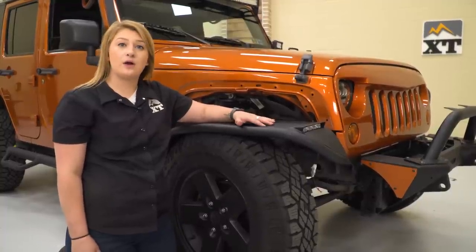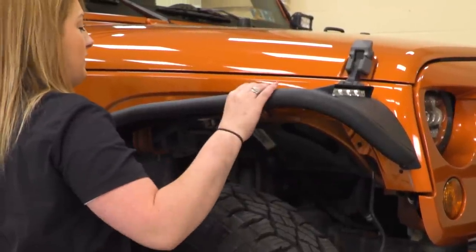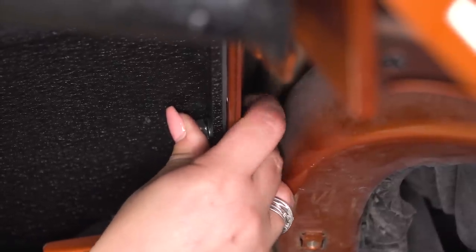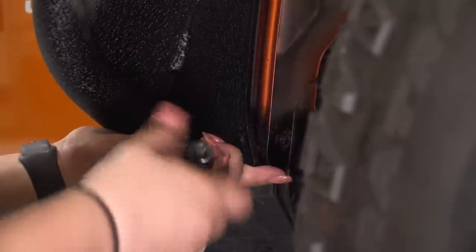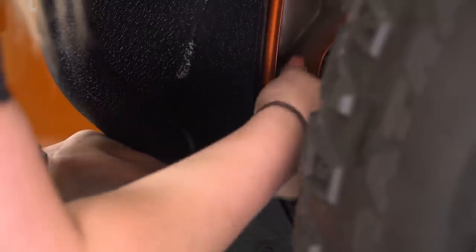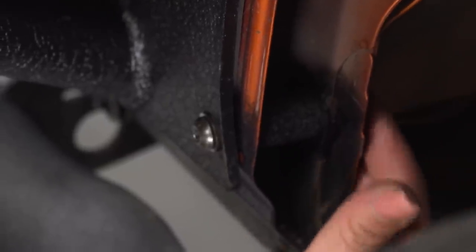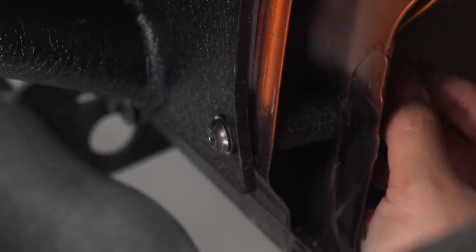With our light in the fender and our wiring harness tucked up and out of the way, we can bolt on our fender. We have this tab here that we can rest our fender on so we can bolt up all of our hardware. Take your 13-millimeter bolt with the washer, then attach your washer and nut on the backside. We are going to loosely install all of our hardware so we make sure that all of our bolt holes line up, and then we can tighten everything down at the end. To hold the top bolts in place so the fender flare is not hanging down on you, insert your sleeve in the middle of the fender well, take the smaller Allen head bolt and bolt it through. Once the Allen head bolt is through, attach the washer and the nut on the backside, then move along to the other bolts.